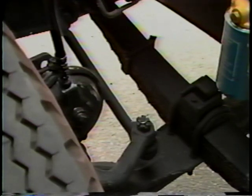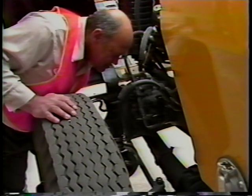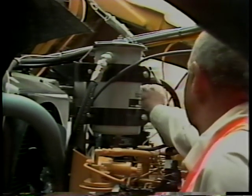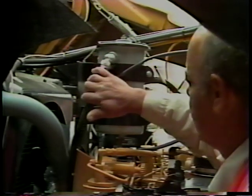Be sure to check the steering linkage for excessive play. Inspect the brake hoses for bruises and cuts. Check the suspension system. The next area for inspection will be inside the engine compartment. Here, the engine fluid systems need to be checked for leakage. Hoses should be inspected for cracks — make sure they are not pinched. Connections should also be inspected for tightness.